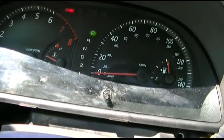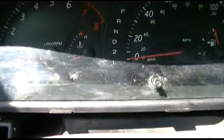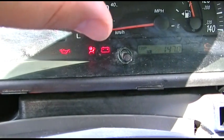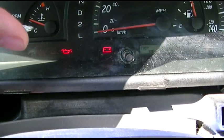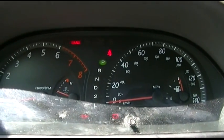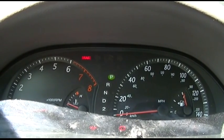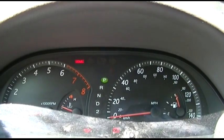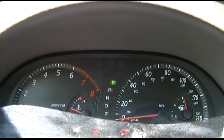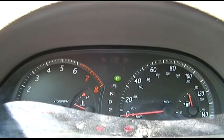And that's it. Now when it's not working, you're going to have obviously no panel. Well, you will still get some warning lights - I'll show you what those are. You will get an oil light, you will have your alternator light, the airbag light also still works. The ABS light I'm not certain about. Now the seatbelt light does not work when the dash is dead. The brake light for the emergency brake or parking brake also will not work when the dash is dead. Now that is also a problem because the brake light doesn't just tell you you left the emergency brake on - if you have a problem with the regular brakes of the car, you will get a brake light if the brake fluid is low.